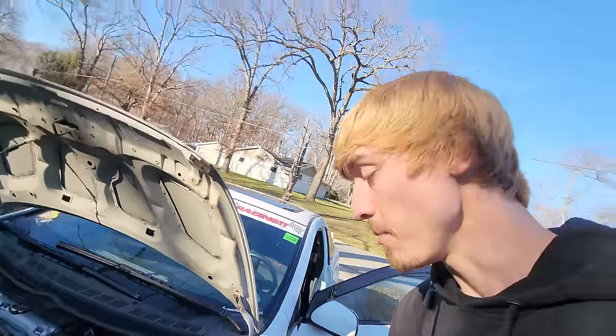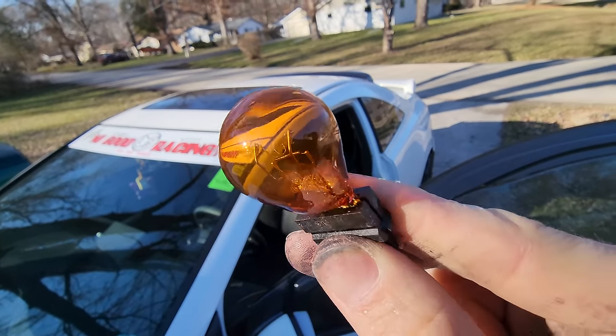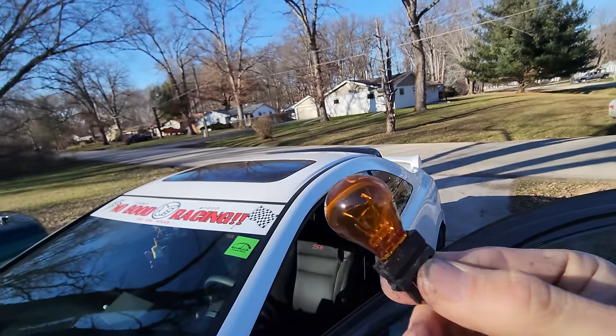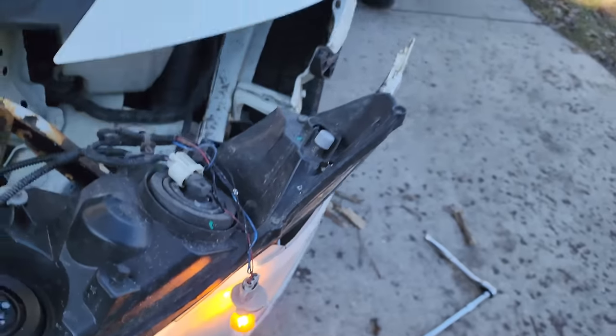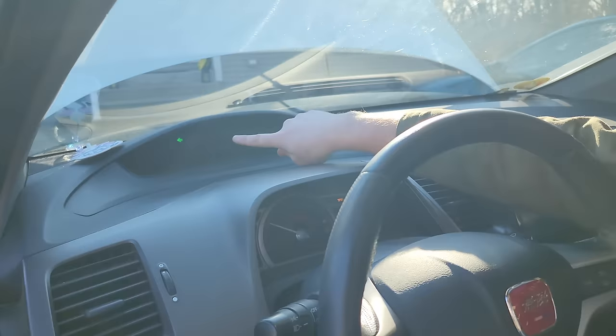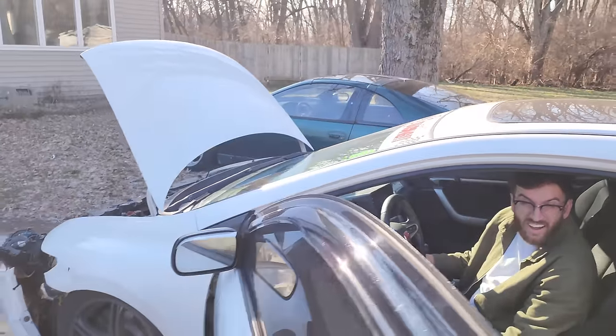Parking lights don't just blow fuses out of nowhere. The suggestion is that this bulb's filament was too long - sometimes the filament stretches out and hits the other filament within the bulb. The problem he was having was that when he put his turn signal on, it would back-feed. One night he signaled left and the turn signal light just stayed on - it wasn't flashing, it just stayed on. The turn signal is still staying on even now.